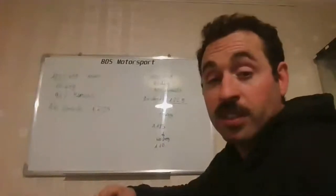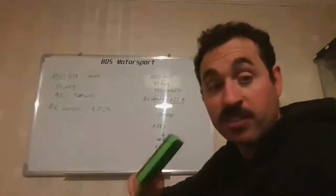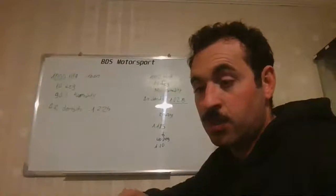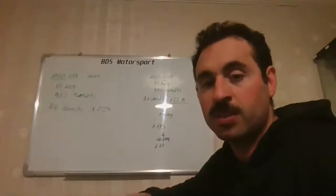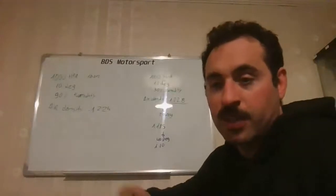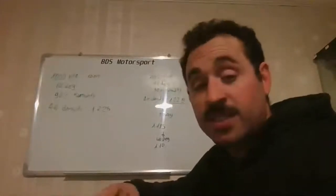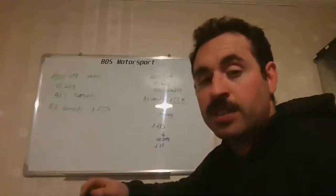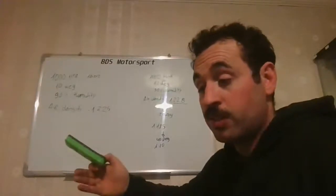But going up in temperature, you will definitely see a big drop, especially if you went to 40 degrees. And generally, it's very easy to get 40 degrees on the intake temp, because that's lower than what your engine bay usually is. Your engine bay is usually around 50 to 60 degrees inside with the bonnet closed. If the car is not moving at all, it becomes really hot. I'm sure you understand, it goes a lot hotter than that. But so this is the thing. As important as everything I have explained before, it all starts in here. It's the quality of air your car breathes, the quality of air your car takes in.